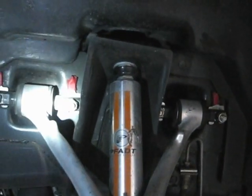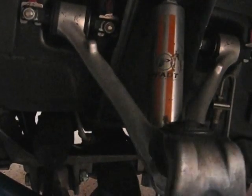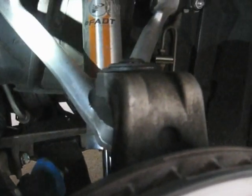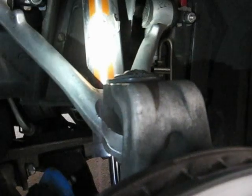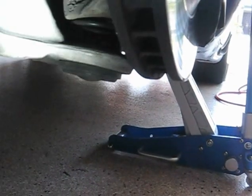It's been probably a year and a half actually. I'm going to try and do this an easy way. What I'm going to do — I've got the car up and I'm going to put a bottle jack underneath the spring. What that's going to do is take the down tension off the corner, the whole corner. Bottle jack underneath the spring. Then the only thing I have pushing down on this upper control arm is the shock. So I may use two jacks, or I may just go under the whole corner, right here basically, right under there.